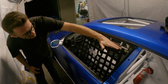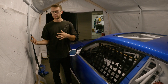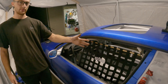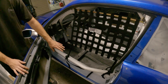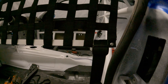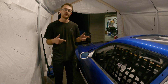We have the net as high up as we can possibly get it without interfering with my helmet. Inside, the biggest issue is going to be your head clearance - there is a clearance number online that depends on what rules and regulations and races you're trying to run. For this car, we tucked it as absolutely far out as possible before hitting the window. This is as good as it can possibly get in this car right now with the cage setup we have. In terms of the bottom, it will be a standard strap style - the proper FIA or SFI rated straps will go on the door bars and hold it down so that when you hit this, it will catch your body, arms, or head in the case of a roll. Window net is done, on to the next thing.